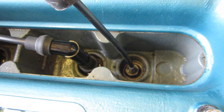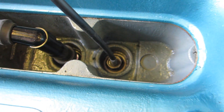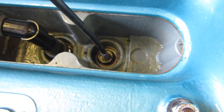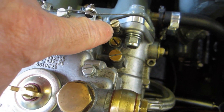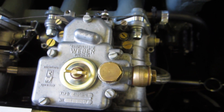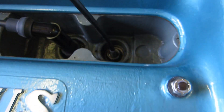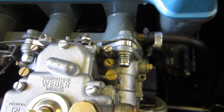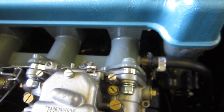I've put a colour tune plug in, which has a glass or quartz top so you can see inside the cylinder when it's firing. This allows you to adjust the mixture at tickover. This is the adjustment screw for tickover — you can't adjust mixture at any other revs because it's all fixed jets and emulsion tubes, so you'd need to change those. But I can fiddle with the mixture at tickover, and my understanding is it should transition from an orange-yellow to a blue colour at tickover.